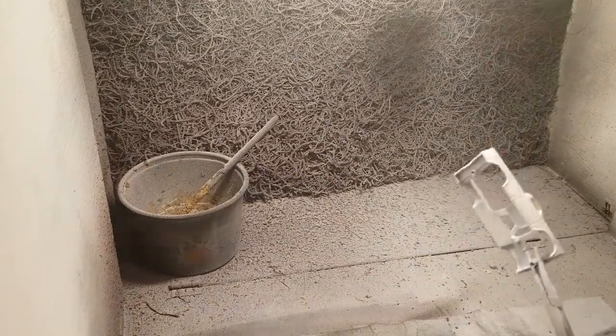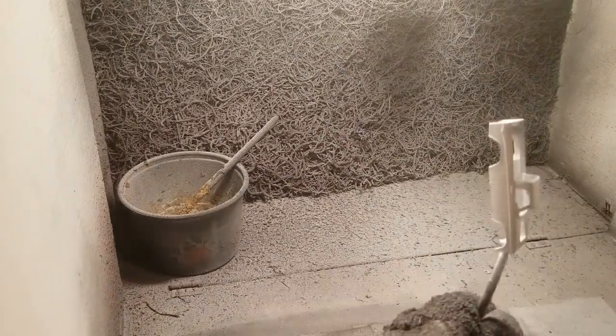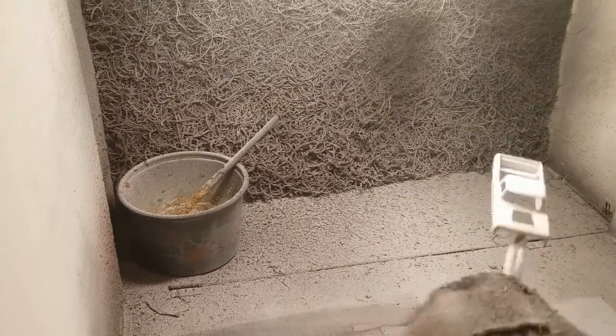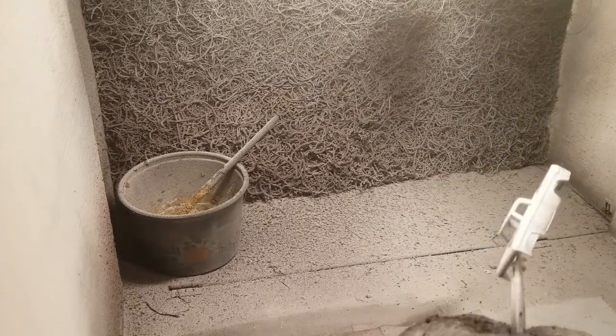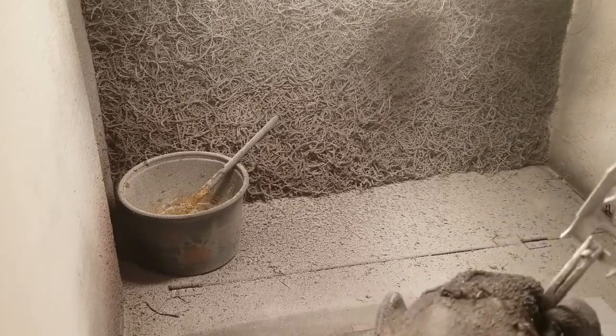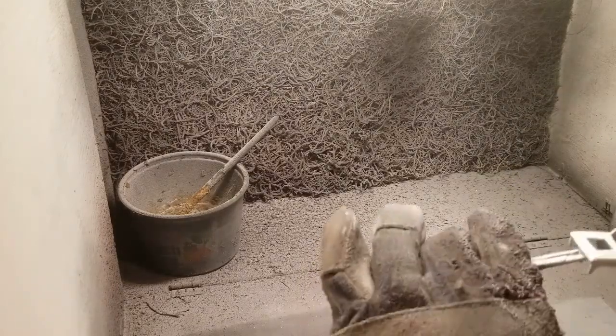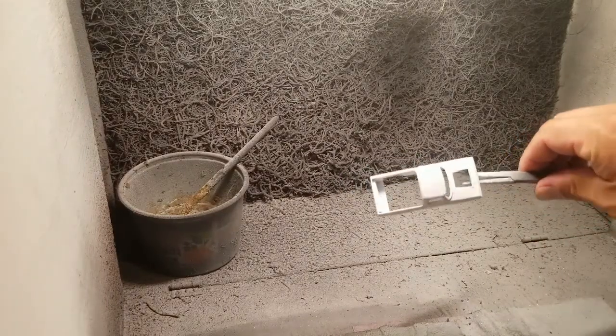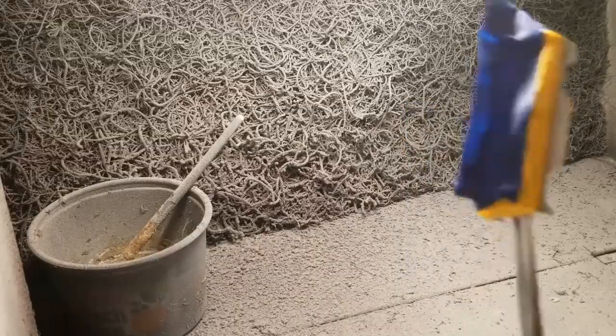So we're going to lay pearl white down, light first coat as usual. You saw earlier, I did add a little 40-30 and a little 40-12 to reduce it just a little bit. Helps flow, helps adhesion. You follow the directions on the bottles, and it seems to work out well.